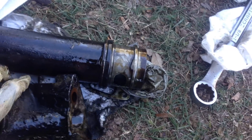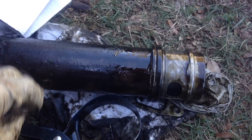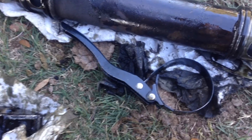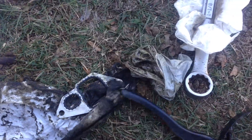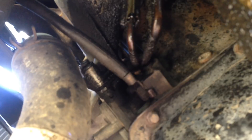The rest of the cooler is still there and still making a mess. Before you take off the front cover, one thing that's been successful in releasing these things is to give it a good twist. I ended up using what is essentially a small car's oil filter tool — it's like the perfect size. You slip that around there and it allows you to twist it and pull it out at the same time, and that releases it really well.